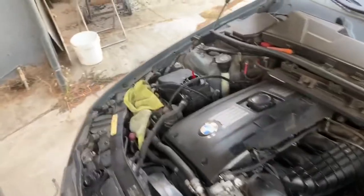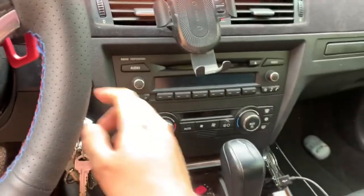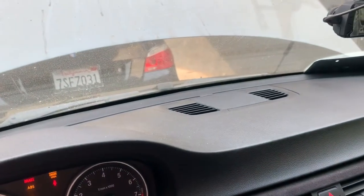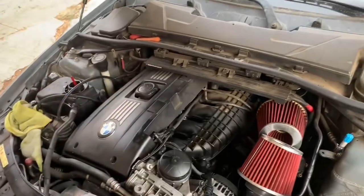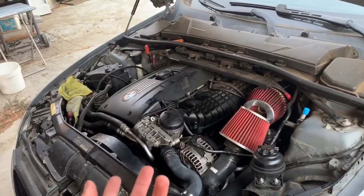I just put in the new hose, and every time — don't forget — make sure you purge the system. Make sure the reservoir is full, then go inside, put the key in the ignition. Don't press on the brake pedal — press on the gas pedal, turn on the ignition, and put the heater on. You'll hear that — the system is now purging, letting out the air. After about 10 minutes, close the cap on the reservoir, then look out for any leaks, make sure you get to operating temperature, and then give it a pinch test.